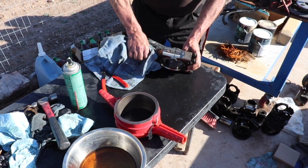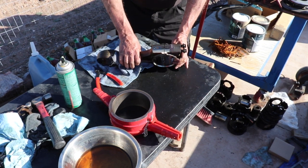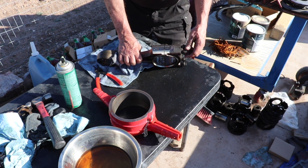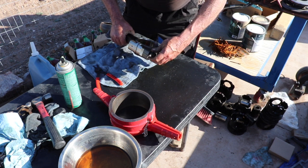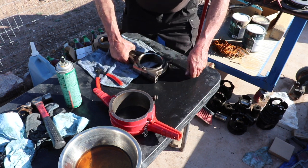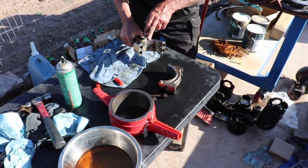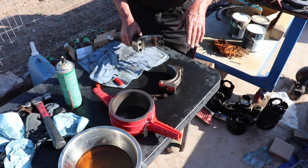Next thing I really wanted to note is that when we pulled these apart — I don't know if you remember in the earlier video we talked about which side was the passenger side based on the numbers — I also went ahead and stamped the rod cap and the rod itself so I know number three matches both of these rods. So we're going to go ahead and split this rod cap right now, just pull the bolts out and separate the cap. The next thing we're going to have to do is clean the inside of the rod without the bearing in it.